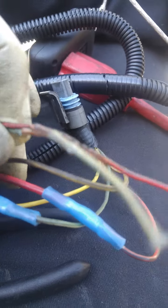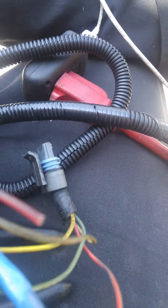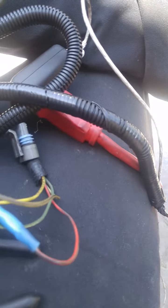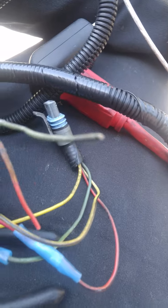For example, the red wire with the black stripe that I have here — that's damaged. Cut out a little section of it, use some heat shrink tube, insert a new little piece of wire. All you do is cut and strip the ends of the broken section out. Then you're going to put a heat shrink on one side, heat shrink on the other side, crimp it, melt it, and it should be good to go. Just make sure you got a good solid connection. I like to use these weather pack ones — they seem to work good. They got like a little glue inside as they melt down, so they seal it up pretty well.